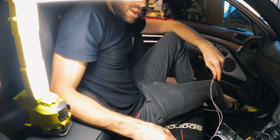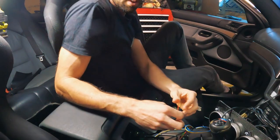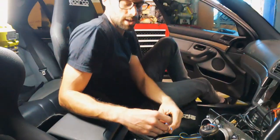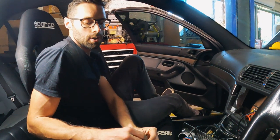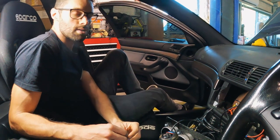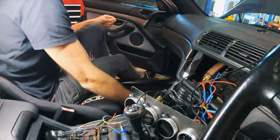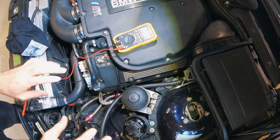One thing that caught me out: I didn't realize that even though these cars do have an EGT sensor, the gauge requires an aftermarket EGT sensor — it doesn't tap into the factory one. That's the only thing that really caught me off guard. Anyway, first thing we're going to do is test the boost sensor in the engine bay — I'll need you for that, Dave. Let's plug this one back in and meet in the engine bay.